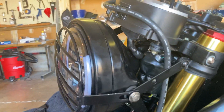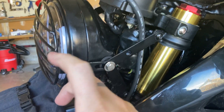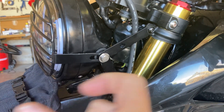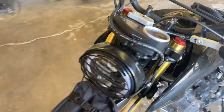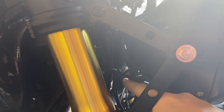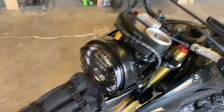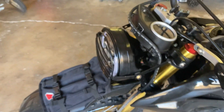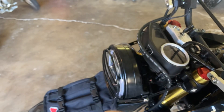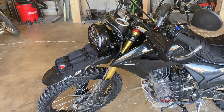One little trick I did — there was a big blob of cables back here. This headlight comes with an H4 converter cable and it was really big, blue and green, and it looked hideous — you could see it right through the side. There's a hole at the bottom, so I put some wire loom over the wires and pushed it up inside the headlight. I know there's a heat sink on the back and the wires are in there around it, so I'm going to keep an eye on it and make sure it doesn't overheat and melt the wires.